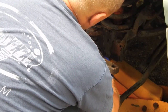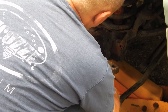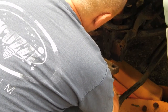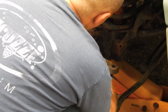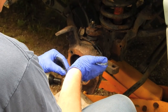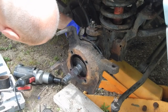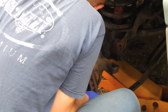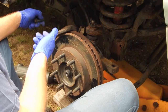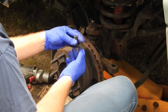I'm just lifting up underneath the shaft a little bit so I can feel right there — I'm up against the seal lip. If I lift up just a little bit, it slides right in. Now I'm going to change my gloves so I don't get grease all over my rotor. Cleaning that surface up really good and putting a film of grease on there is important — if you don't, you can have a bear of a time rotating that hub assembly so the bolt holes line up.